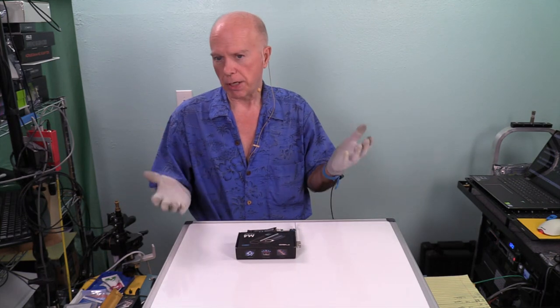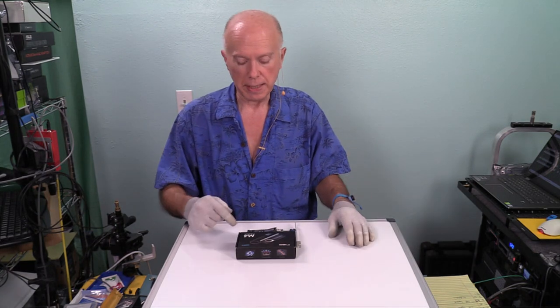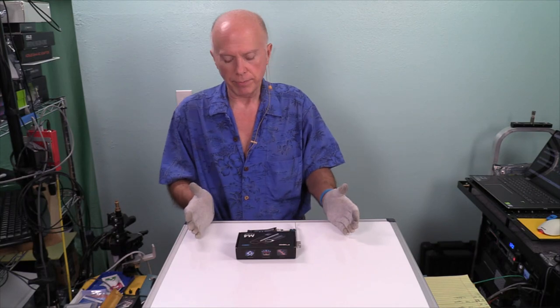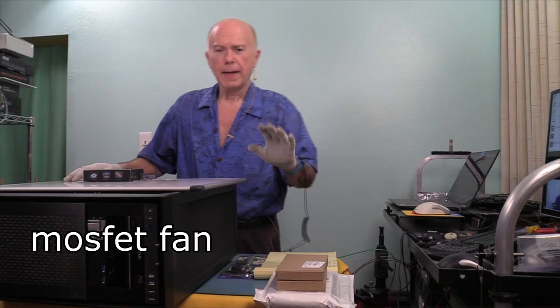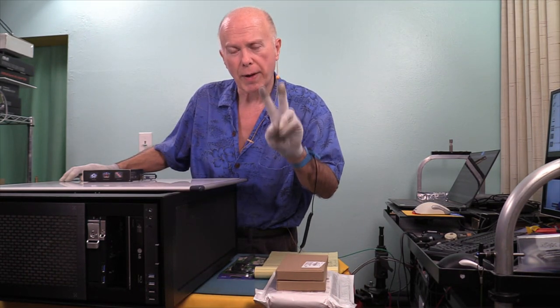Because this has a fan on it, there are some mixed issues. My concern is that smaller fans make more noise. That particular fan has driven some people crazy with the noise. I'm concerned because we're not looking at one — we're possibly looking at two or four. Each fan has to have a fan header to the motherboard, which creates another topic for a separate video. We need to test this two ways: one with the fan plugged in, and one with the fan not plugged in.